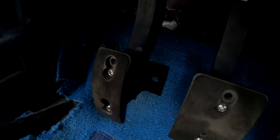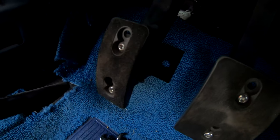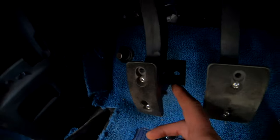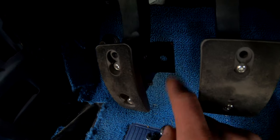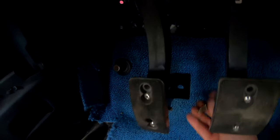I've been working on making a clutch pedal stop. Long term I'm going to go to a billet aluminum piece, but just for getting the car up and running this piece will be more than enough. It's made out of quarter-inch steel bent into an L shape. I have two holes drilled here which grab the two bolts that come through the pedal body to hold the face of the pedal on, and then there's a hole in the back for a 3/8 bolt to go through with a jam nut, which hits the floor to stop. It's not ideal to have metal banging on metal, so I might put a thin piece of foam there to isolate it so you're not getting a clanging noise every time you hit the pedal with force.